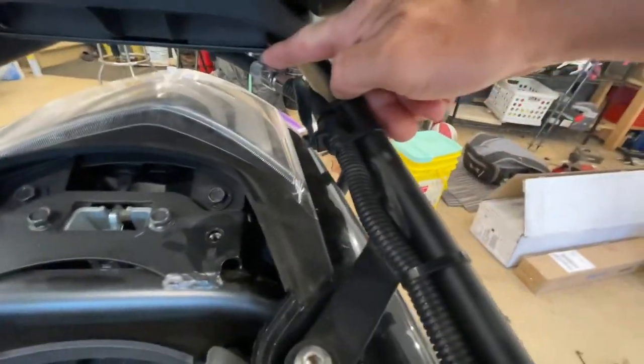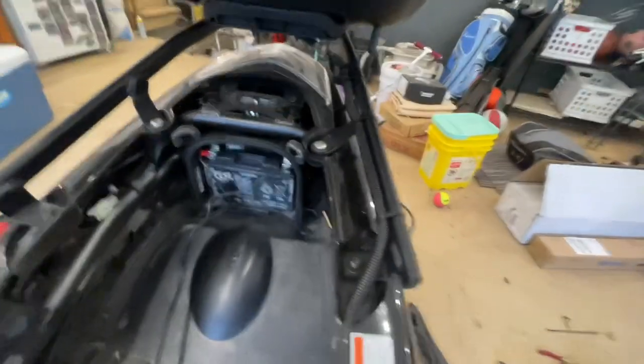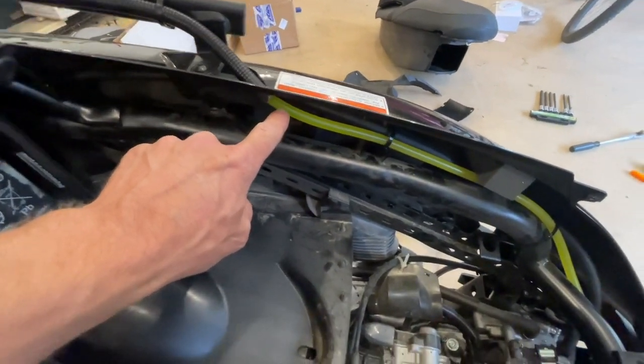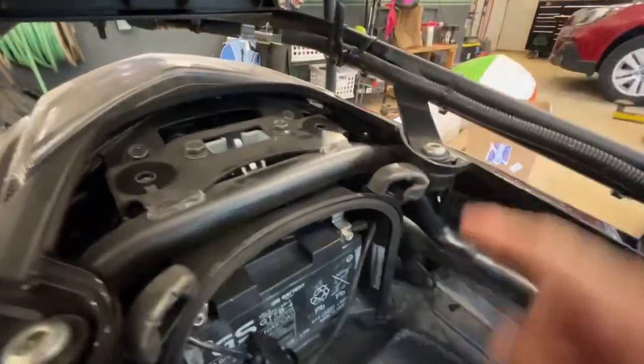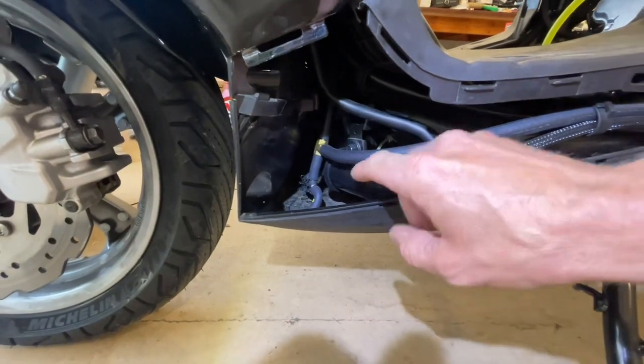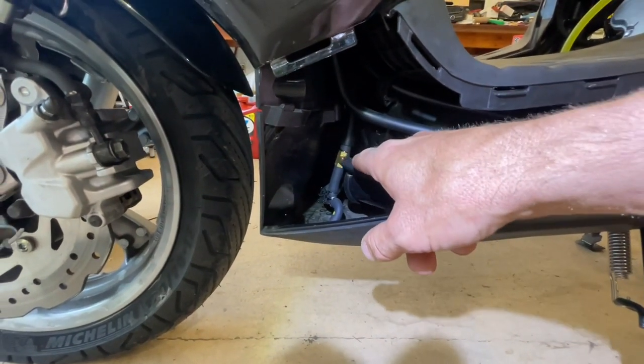Then it comes up here — there's a drip-free quick disconnect so I can actually pop this trunk off, and I've got a ball valve on it so I can shut off the line and not overfill the system. From the other side, you can see the fuel line runs through a drain hole I drilled just a little bit bigger, straight shot into the top of the factory tank. The vent drops down, goes through a hole I drilled in the back, runs through just behind the other line, and tees right into the factory vent line where it would dump to the ground if it were to overflow. So it's basically teed into the factory system wherever possible.